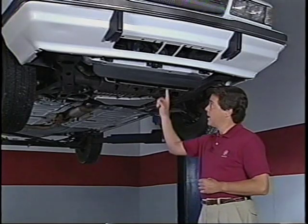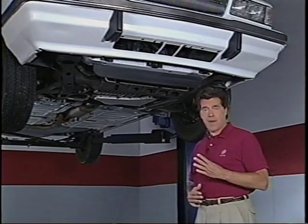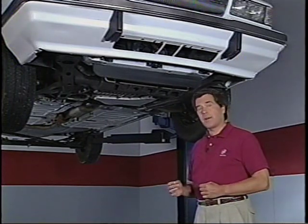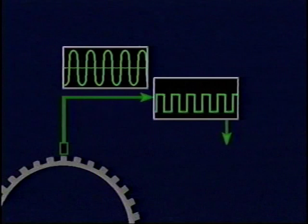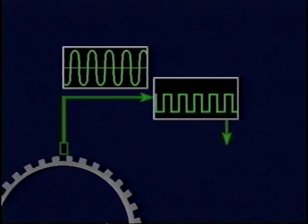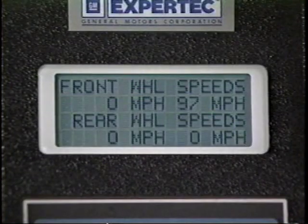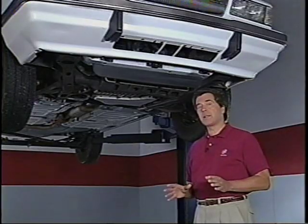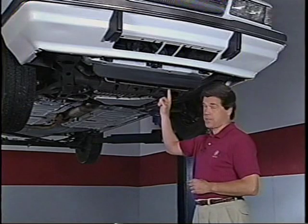The transaxle mount is part of the cradle, which is insulated from the body by 4 mounts. A direct short to ground here does very little harm to the vehicle. It does, however, have an indirect effect on the wheel speed sensor circuits. Battery voltage can arc from a speed sensor tooth to the pole piece. This produces some extremely high indicated wheel speeds. Whenever inspecting the front wheel speed sensor areas, always check the battery cable in this area.